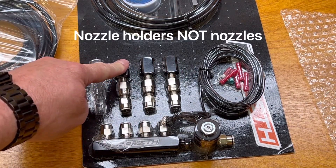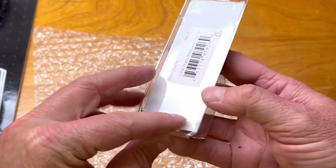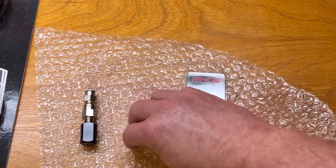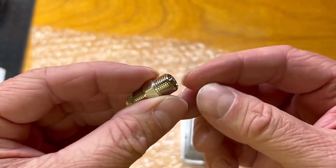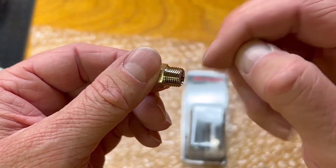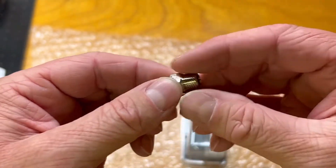These are the low profile nozzles I had to buy from Snow Performance. I did some math on the Pro Meth website to convert cubic cc's per minute to gallons per hour, and I figure I need about 2.5 gallons per hour times four to feed about 600 horsepower. The nice thing about these nozzles is there's a recess cavity that creates little eddies and vacuums to help atomize the mixture. With lots of boost pressure coming in, it won't make a big cloud — it just integrates right into the airflow.